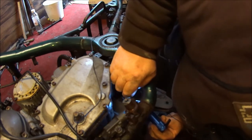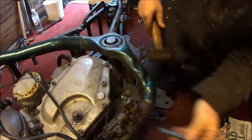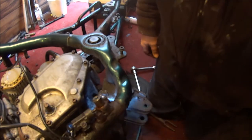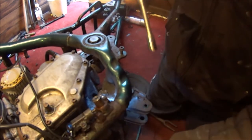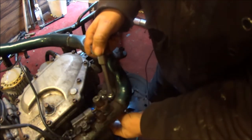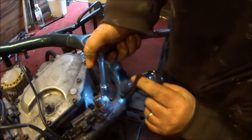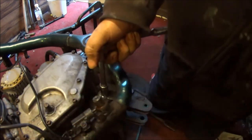Yes, it's a lot older than it looks. If you could get the angle grinder in there it would have gone through in seconds. I don't think I'm anywhere near through it yet. So I've got the ratchet on the end of the bolt - this is like six hours later from the last time you've seen me. I'm going to put the mole grips on the bottom of the bolt down there. I've cut through it as much as I can, and now I'm just going to try and snap the bolt with the ratchet. Let's see what happens.